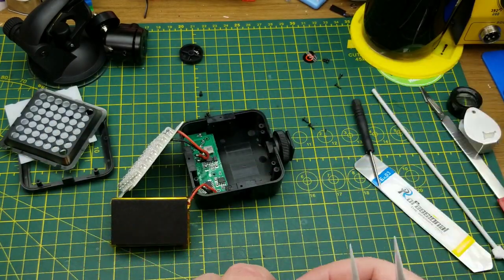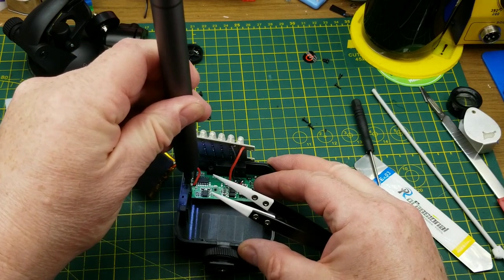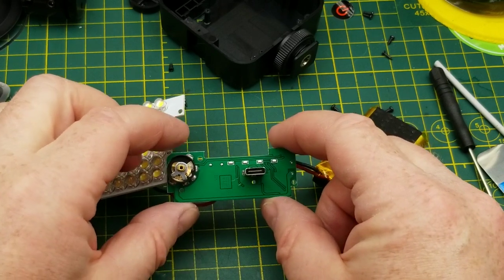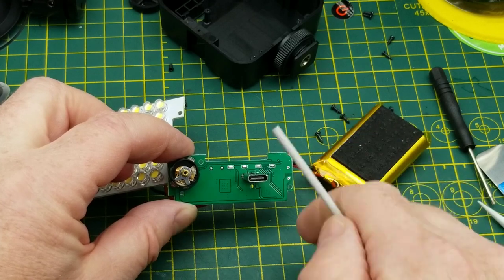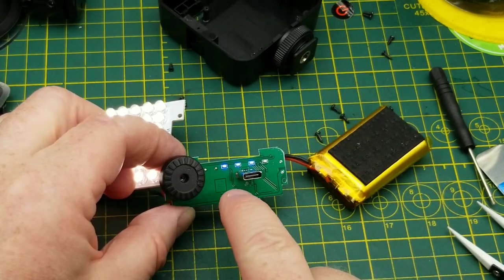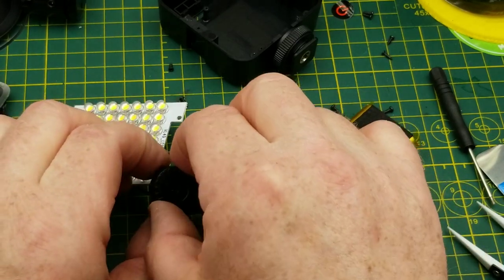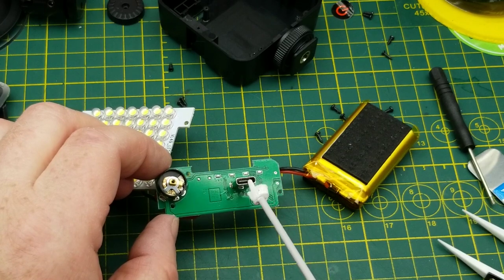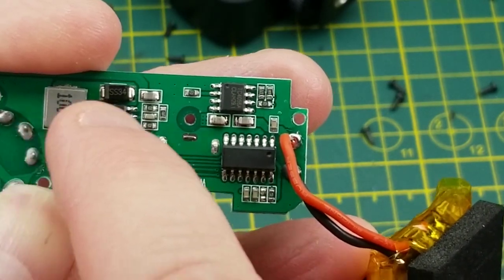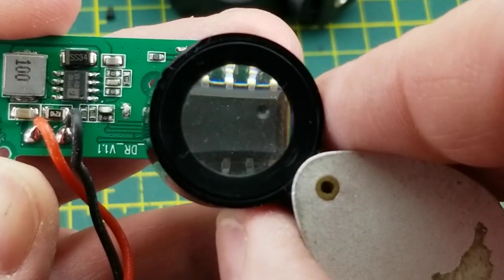Because there's still power on that board and no way of disconnecting it, I'm going to use my ceramic tweezers to remove those screws so I don't short anything out. And there we go — that's it out. On the circuit board we can see the four little LEDs for state of charge. If I turn it on, you'll see they light up nice and blue — three out of four. Those LEDs over there on the panel all light up as expected, so I haven't broken it yet. The only other thing on this side of the board is the USB-C port. Getting closer to the board, there are basically three chips on it, an inductor, and a diode — a three-amp Schottky diode.